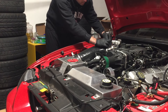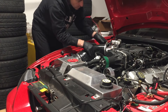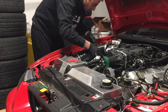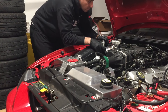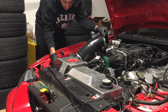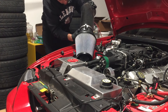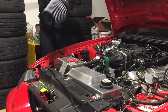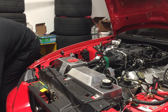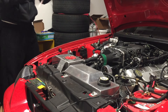The passenger side is a little more tricky — you have to take the band off and get the intake off. What I like about this intake is it's silicone, so it bends easily. It does have a really good seal, which makes it difficult to get on and off, but it comes out as one piece without having to remove it in multiple areas. It has the mass airflow sensor and the intake air temperature sensor. I put a little oil around the rim to slide it back on.